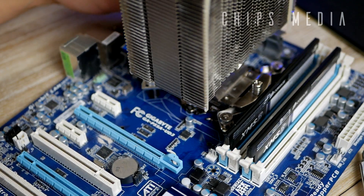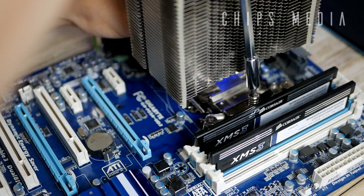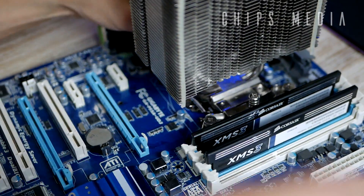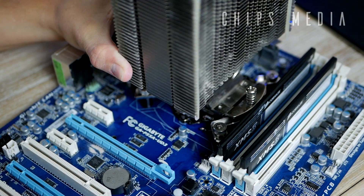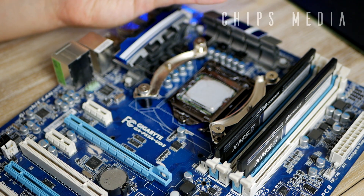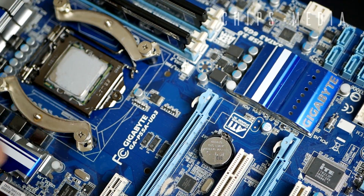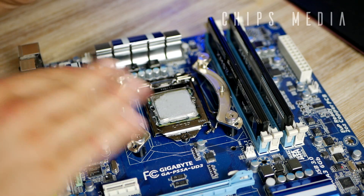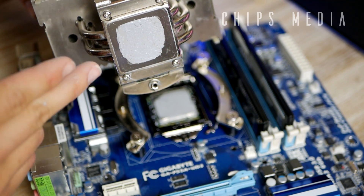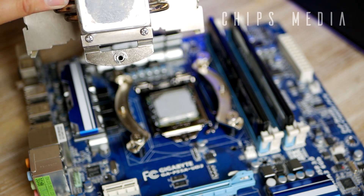Heat sink is successfully installed. Time to take it off and find out. Why is a video like this necessary? Well, in my opinion, I've seen plenty of people go completely overboard with this. And there we go — awesome, almost completely covered as well. Probably should have moved the lump more into the center, but as long as you cover most of the CPU you're gonna be fine. Taking a look at the heat sink, we probably could have used even less compound here.